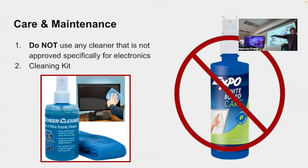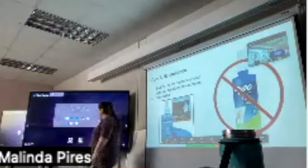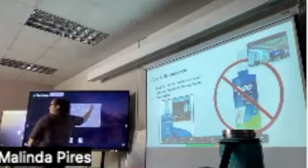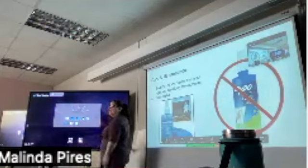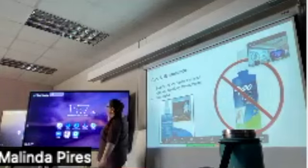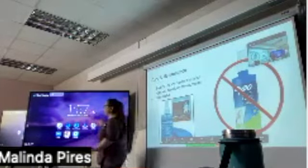The next thing is care and maintenance. Don't use just any cleaner and squirt the panel — you could ruin the screen. Only use electronics cleaner; everyone who was here at the hundred-board session should have a little kit with a soft cloth. Also make sure water doesn't collect at the bottom near the cameras. They're pretty well protected, but water and electronics don't mix. It's better to spray on the cloth first, or if you spray directly on the screen, wipe it off right away.